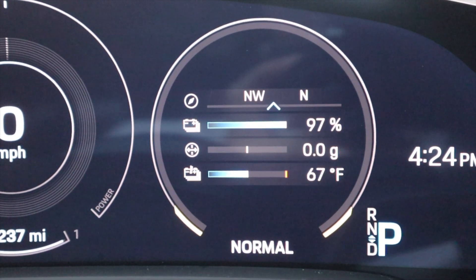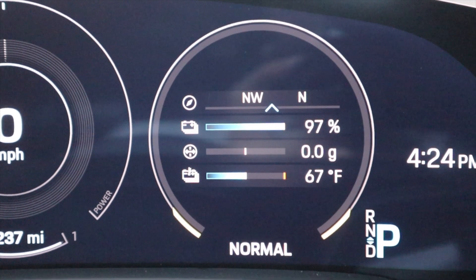Now I can see that the battery temperature of my Taycan is 67 degrees. It's a little cool to hit those optimal charging speeds — it needs to be heated up a bit. But if I were to set the destination to an Electrify America charging station, the car would automatically start to heat or cool the battery on my way there.